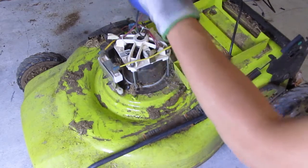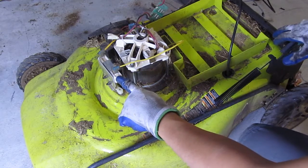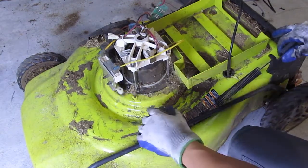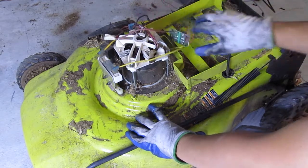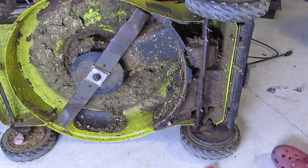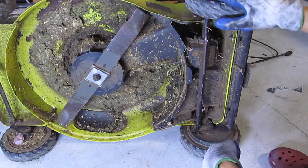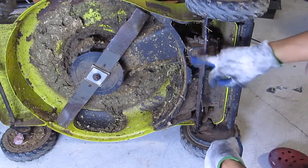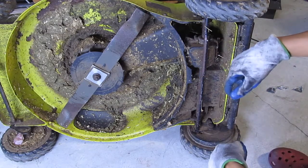Let me show you what's inside this machine. There's a 48-volt DC brush motor, a giant ceramic resistor — it's a 50-watt resistor, it's humongous — and there's even a heat sink on the side along with a switch. Here is the bottom end of the lawnmower, and being a self-propelled mower there must be a motor here to run the rear wheels. This box here — not sure if it's a gearbox or a motor — I'm going to open up and check it out next.